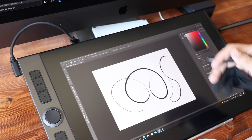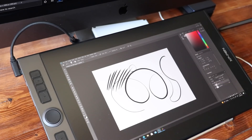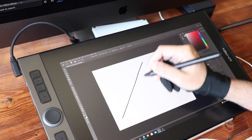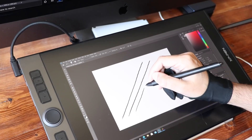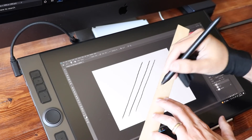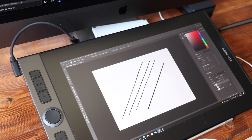Let's give this a roll. I'm going to start by just testing the pressure — everything looks pretty good, pressure is working. Going to get some quick brush strokes in here just to see what's happening. We get a little bit of shoestringing, but nothing too terrible. The big test are those lines, so let's draw some slow diagonal lines at different speeds. And I am seeing a lot of mechanical wave on this too. Just to make sure it's not my hand wobbling, I'm going to use a straight edge and draw that line out. Yes, we're seeing something very similar — a lot of indents to the lines when they're on an angle. It looks like it's happening on the hardware side. I'm going to wait for that Mac to finish reinstalling and test it on there just to make sure, then I'm going to contact XP-Pen and see what they have to say.